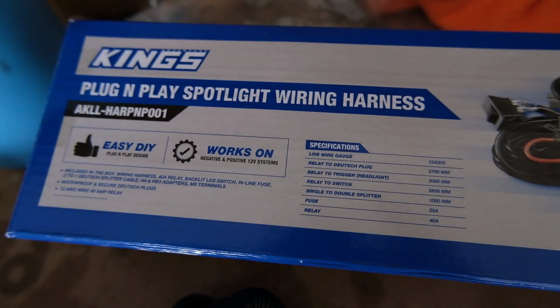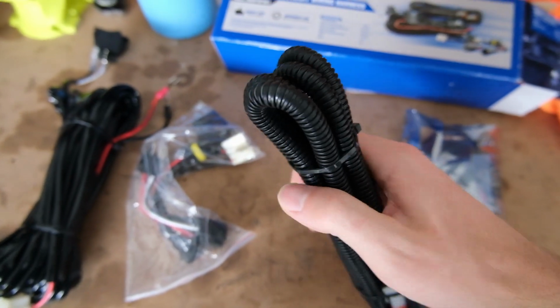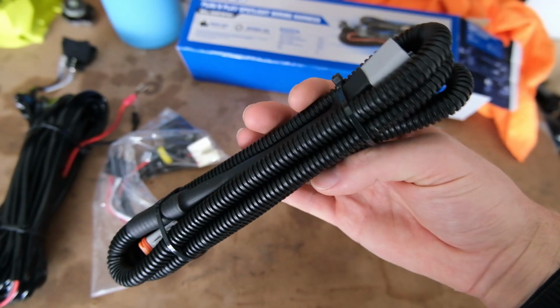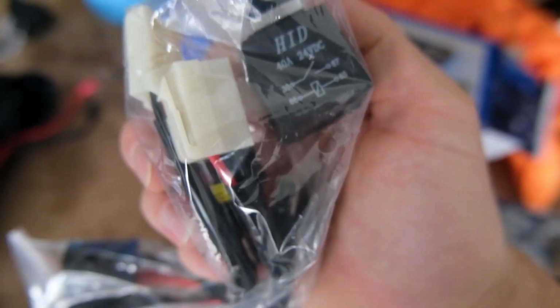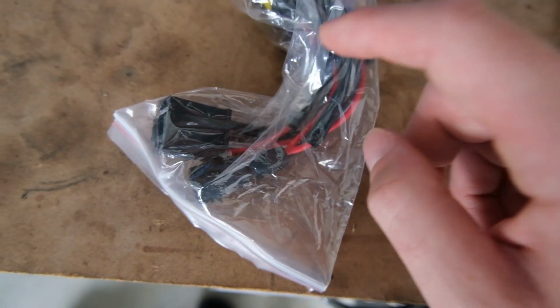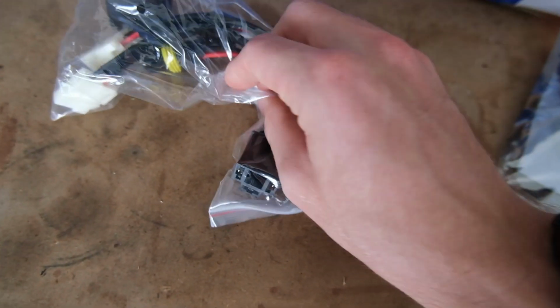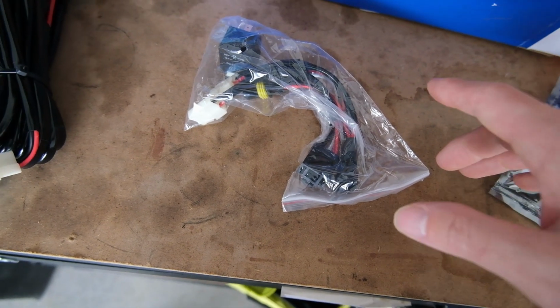So what we have is a King's plug and play spotlight wiring harness. That comes with 3 things. This is if you're using spotlights, because you obviously need to run two lights instead of one, so we don't need this. See you later. This is a relay we're not going to use because we don't need 24 volt. This, I believe, is a plug for the back of the headlights. So it's like a little piggyback harness kind of thing, which means that when we turn our high beams on, the light bar will come on.